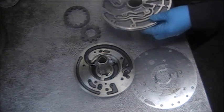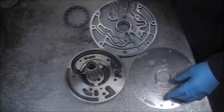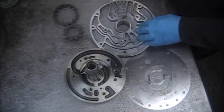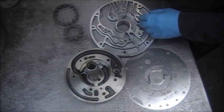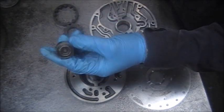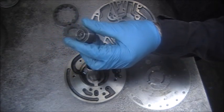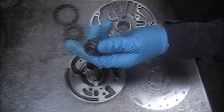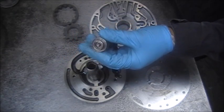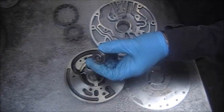What I have here is the pump. This is the part — these are the gears. What I'm concerned with here is this flow control valve. This flow control valve I would recommend to be replaced every time you go into that transmission with a rebuild. If you're going to rebuild it, repair it, take that pump apart and replace this flow control valve.